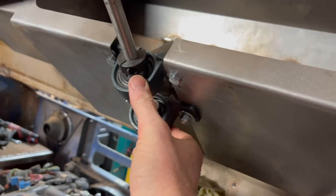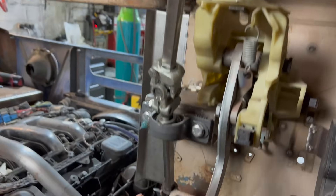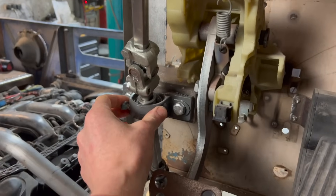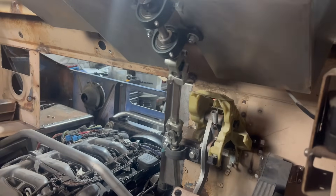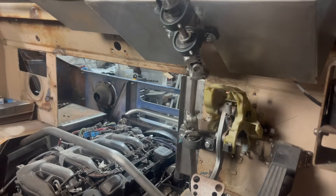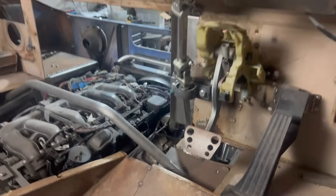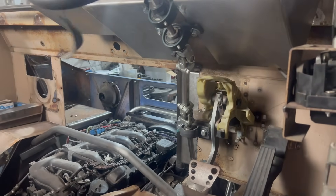With the brackets welded in and the dash nice and secure, we were able to fit these two top spherical bearings. That enabled us to work our way down the column to the steering bevel box — the offset box, whatever you want to call it — and put in this intermediate pillow bearing as well. The steering column is all in, all the support bearings in place, and we have a silky smooth operation. Steering columns can often be a nightmare with these post vans since they're so short, hence the deflection box, but no aggressive angles on the UJs. Super happy with how that operates.